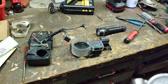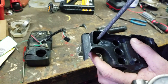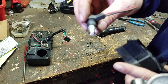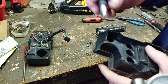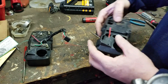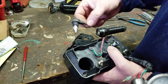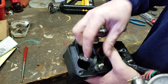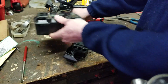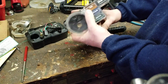I did a crappy job honing it out and making it bigger — I didn't match it properly. But all you need is an extra socket. This is a different style bulb — I have some extra ones kicking around, but it will fit in here. Make sure you do it so it's snug. Then you're going to take these two wires and tap into one right there — solder the red to the red, the black to the black, heat shrink it, and then you'll have your second light.